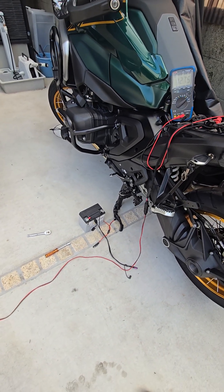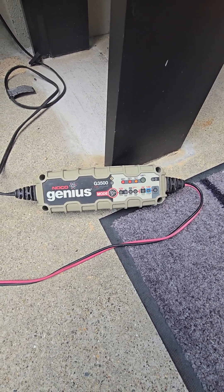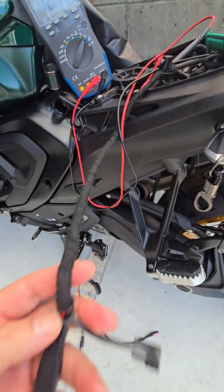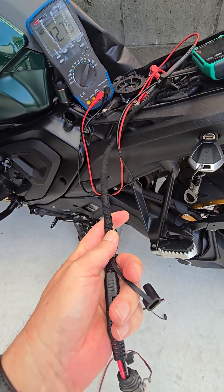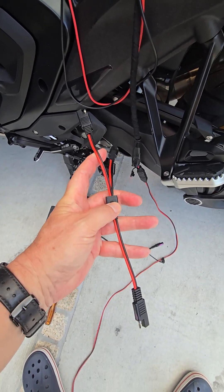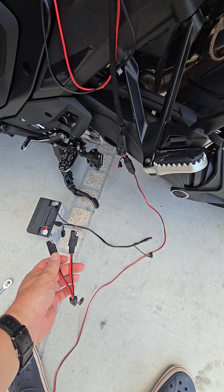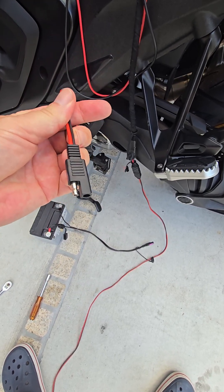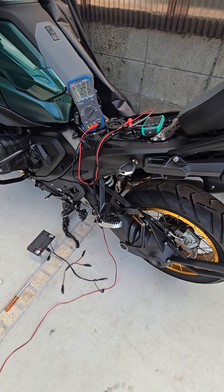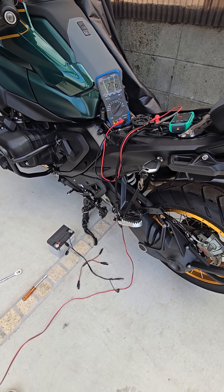So if you guys want to know how I woke it up — I've got a NOCO charger here. I've currently woken the bike up and it's charging. How I did it: I have a SAE connector connected directly to the battery. I've got a Y connector — one part of the Y to the 12-volt lithium battery, the other part to an old AGM 12-volt battery that still holds a charge, and then this one goes to the charger. If I just connected the charger directly to the battery, it wouldn't charge and the charger wouldn't turn on in lithium mode or change modes.